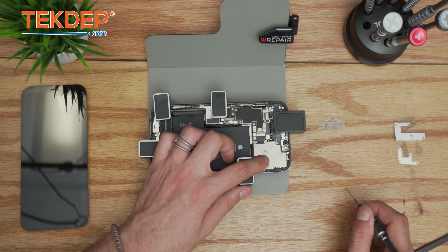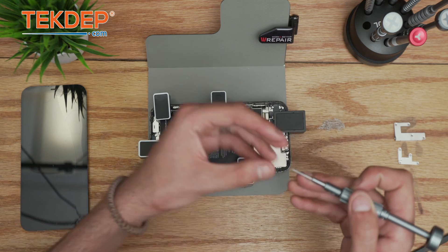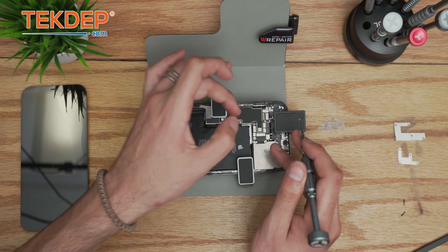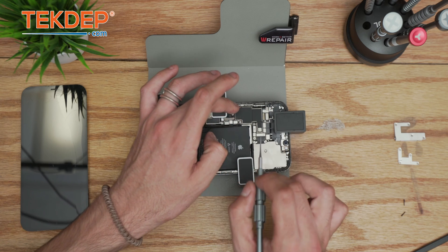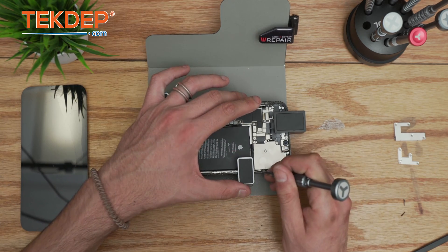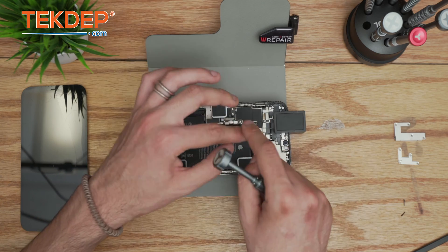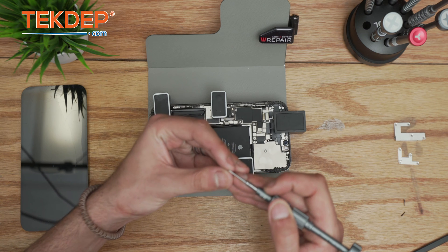These types of issues arose more commonly in older iPhones like the 7 and 7 Plus. Back in those days there was a well-known issue called the iPhone backlight problem: when changing the screen, if you accidentally touched the connector area near a transistor, you'd get a black screen. Later, looking at the schematic, you'd find the backlight IC chip — which regulated the LCD lighting — had been shorted. Apple eventually fixed it, but it was a common frustration for technicians.